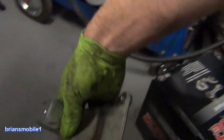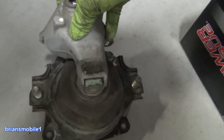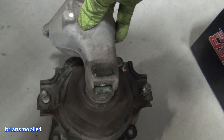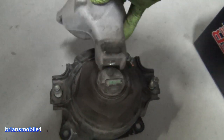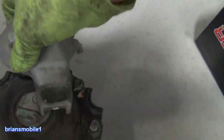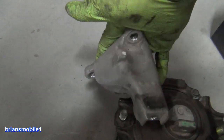That gives you a little bit of a gap so that you can get this bracket off the top of the motor mount. Because they'll be like this — this will be pinning it down, so even if everything's undone it won't go anywhere until you raise the engine a little bit. Then that creates slack so you can unblock these. I do this one first, slide that over, get this bolt, and then once that one's done, slide it back the other way and get this bolt the rest of the way.